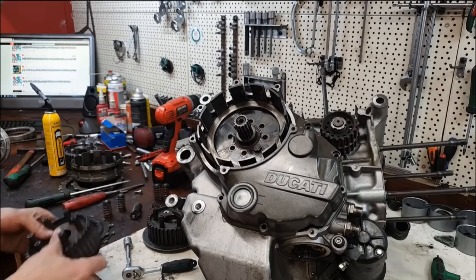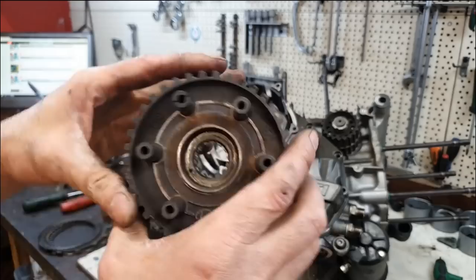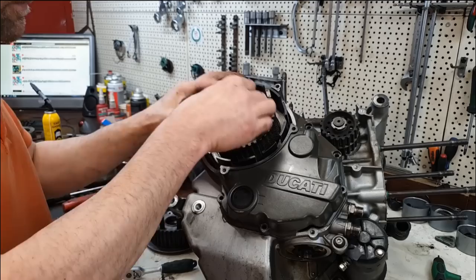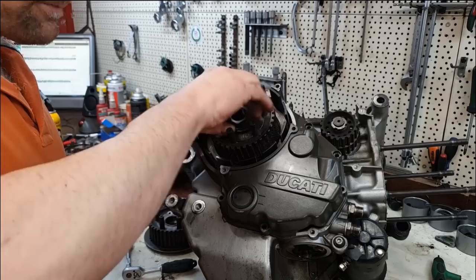In this case I took a drum that is damaged here, but I want to show you how you can fix this problem from the wearing out in the aluminium easily. You put the flower shape shim on there, one, and another one. In this case, it will fill up the part that has been worn out. And when you tighten it up, it will lock the transmission part from the drum and the drum itself back to the position it should be, and it cannot wobble around anymore.